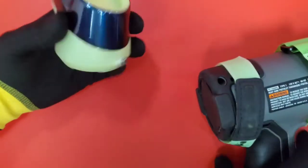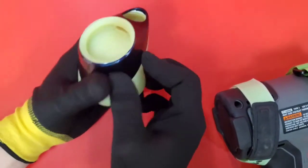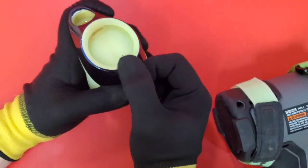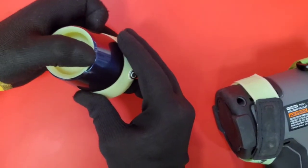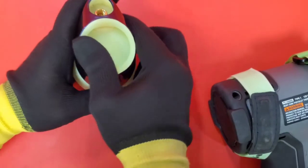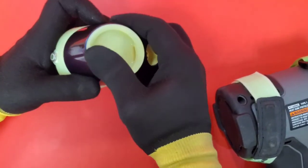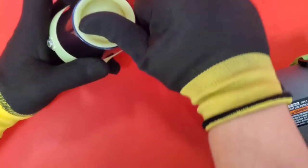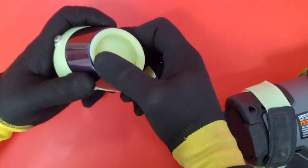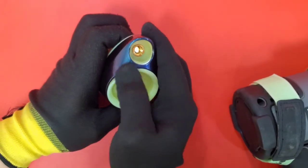Okay, now for this back rim here, just going to start with rubbing against the edge here. And we're just going to lift the rubber back just a little bit to allow the vinyl to tuck in, and we're just going to do a rolling motion with the thumb here, just going over the entire base. You kind of want to roll into it so that the vinyl doesn't crease on itself. And up towards the front here, generally you really don't even need to.